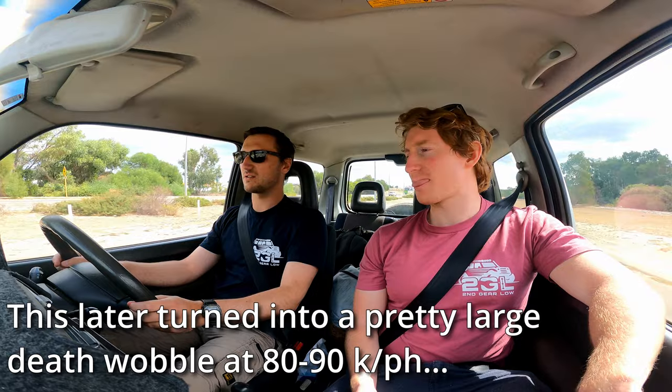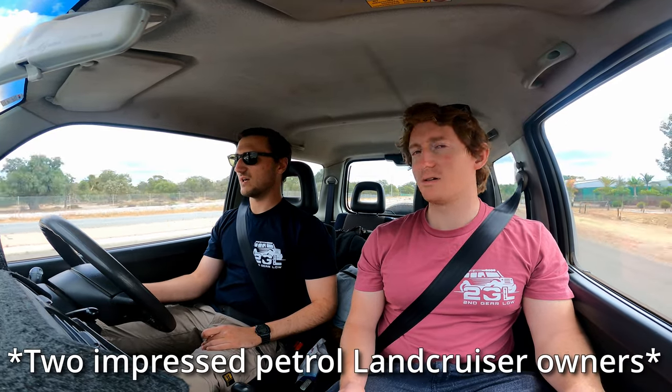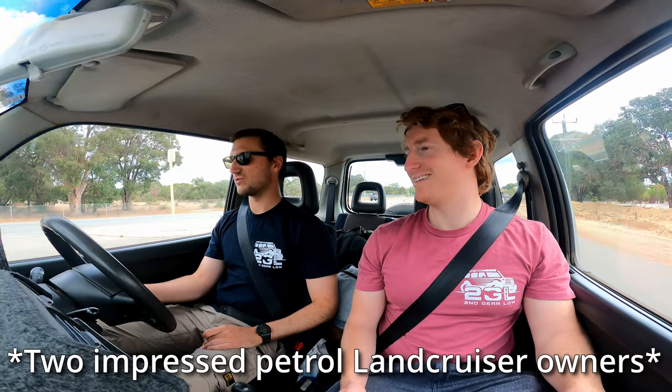It's a zippy little machine — it feels like a go-kart. There is a little bit of wobble in the steering wheel at 70. I don't know whether that's the wheel bearings, but suspension is definitely on the list of things to check out. We probably need new shockers, and some of the rubber bushes look a bit worn. It wouldn't go into overdrive but I haven't noticed any issues — topping up the ATF might have helped. We've done about 70k since I fuelled up and it's barely moved the needle.